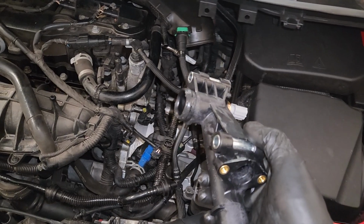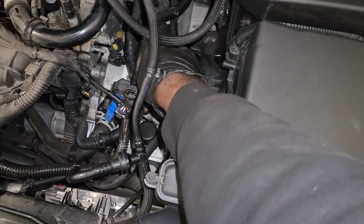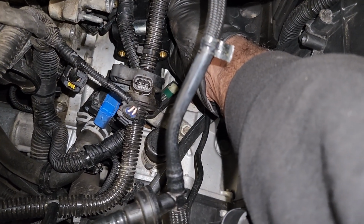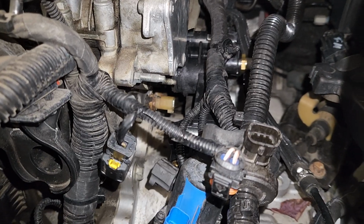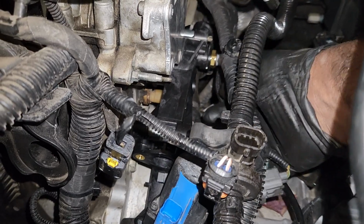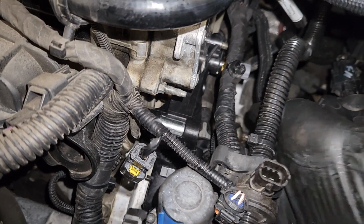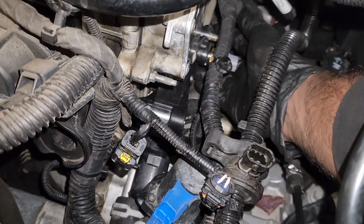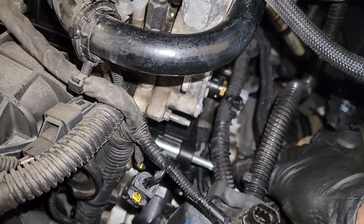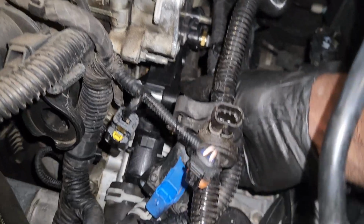It wasn't expensive. So I'm ready to install it, but I apply a little bit of sealant on the o-ring, but not too much. Before I fit the outlet pipe in, I clean the hole inside the cylinder head where the outlet pipe feeds in. Make sure there are no old o-rings or foreign material where the o-ring seats. Once you fit the outlet pipe back in, you can use the bolts to secure the pipe.